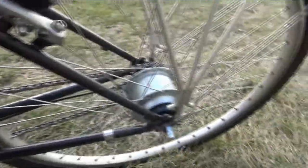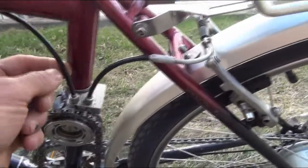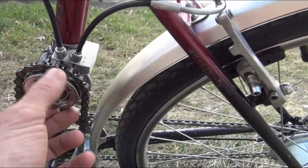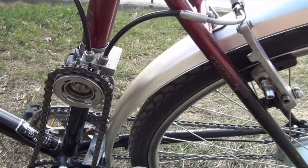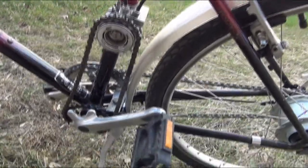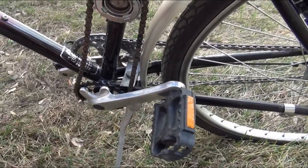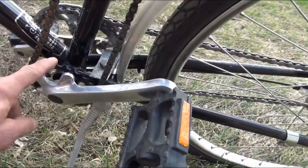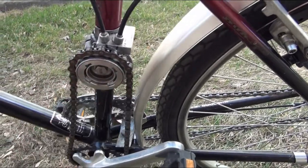The brakes, most importantly, besides the coaster brake in the rear hub, which is set just outside of the range of the cable-operated brakes. This is a device I assembled myself, designed myself, but the concept is something that was on Tracy's previous bike that got stolen. So basically on the left-hand crank, turns out it's also a right-hand crank with chainring bolt holes, with a small chainring that through a secondary chain drives a one-speed freewheel.